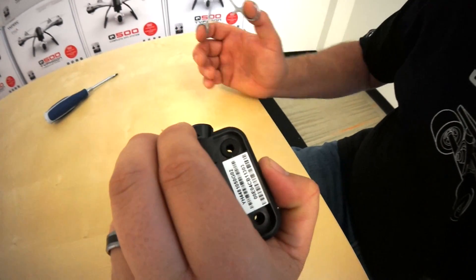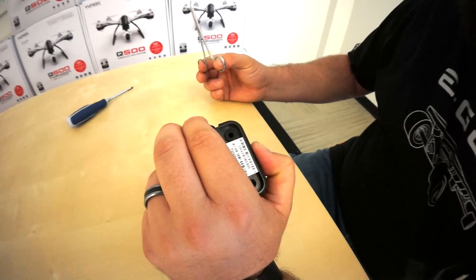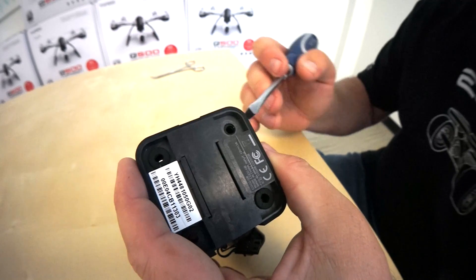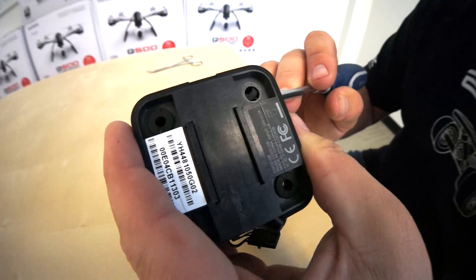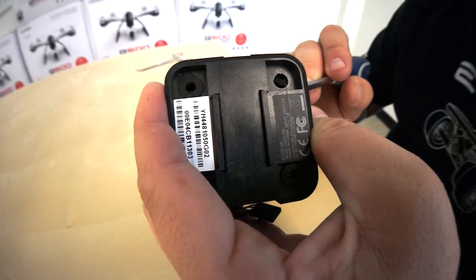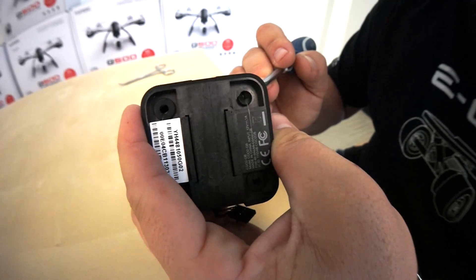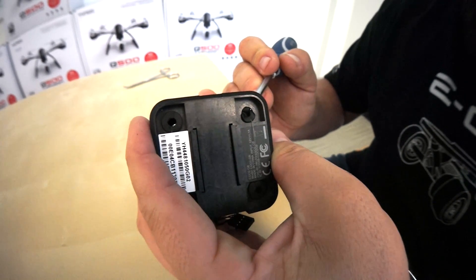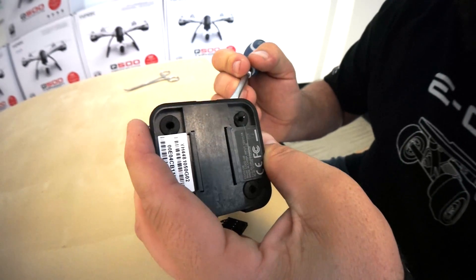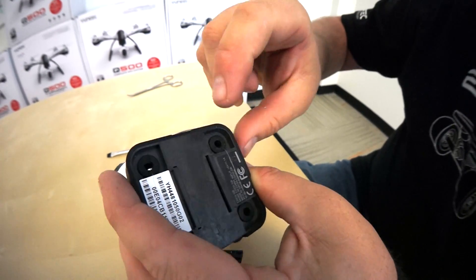This can be a little bit tricky as there's a safety line to prevent the camera from fully disconnecting. Using the flat bladed screwdriver, this method is a little bit harder to do. Our goal here is to get half of the damper in with the screwdriver and then work the rest in with our finger. Once we get to about this point, we can actually use our finger and work the rest of it up.